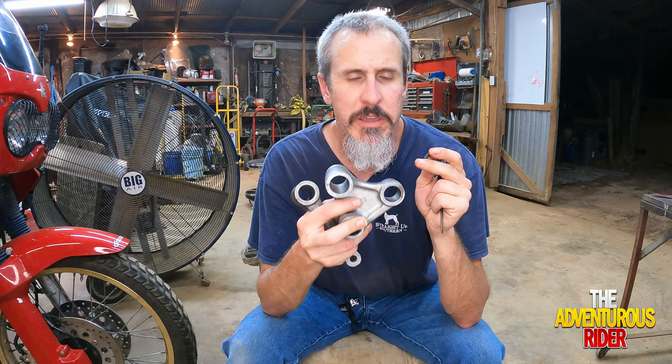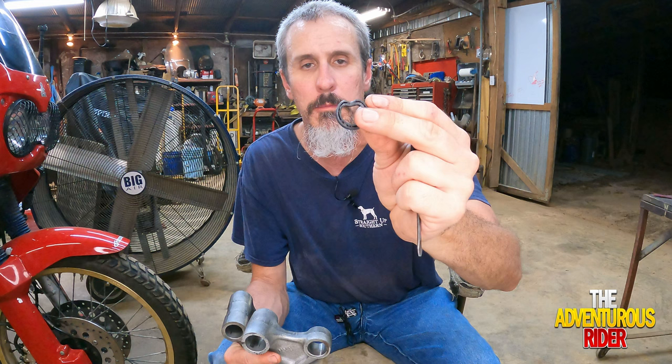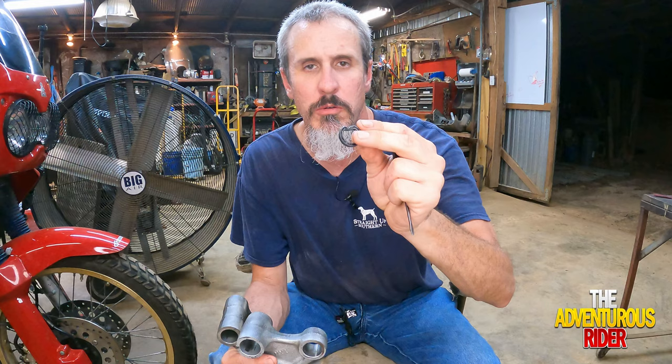It's been a few days since I got all the parts off the bike and everything cleaned up, and I decided to go ahead and order new bearings for our linkage right here. Let me show you how I went about pulling the old bearings out. You have what they call a dust seal on the outside of your linkage, and as you can see when you go to take it out you're going to mess these up. So make sure that you have new dust seals before you start this process.